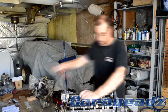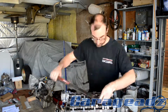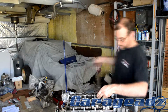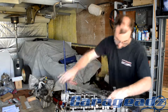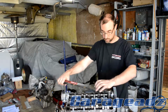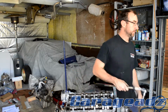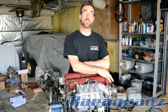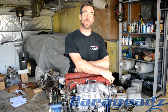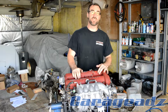Last one. There we have it, it's all down. If you're getting a rhythm and speed wrench it, well, I left out all the exciting bits for you. So I went in, put the timing belt on, torqued the cam pulleys up, put the intake on, put the fuel rail on, all that sort of stuff. Just nipped everything up in general.